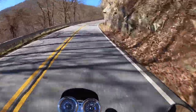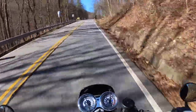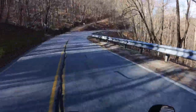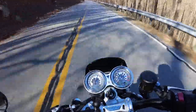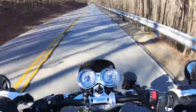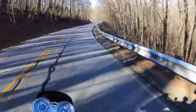When you get on the gas, the back doesn't squat anymore, so it doesn't come off the turn and run wide — it kind of holds its line. When you come down in the braking, the front doesn't squirm as much, it's much more supportive. That's what's really nice about what GMD CompuTrack did for this. A lot of people just crank up the preload to make the front stiff, thinking that's what it needs to handle — but it's not. You want it stiffer so you're not bottoming out because you're braking harder coming into the turns, but you also want it to be compliant — you want it to soak up the bumps when you're not riding at an eight or nine tenths pace.